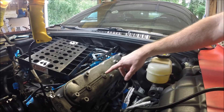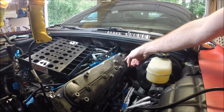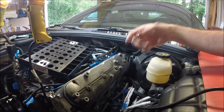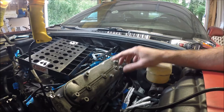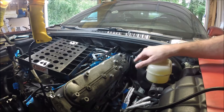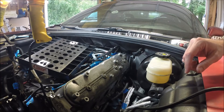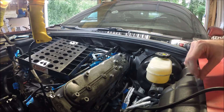My process here: I'm going to take the valve covers off — they've got the four center bolts — the valve cover will come off, then I'll start pulling the rocker arms off, pull the push rods out, and then I'll start taking the head bolts off. Once I get that out, I can get to the lifters as well. We'll get started and see how it goes.